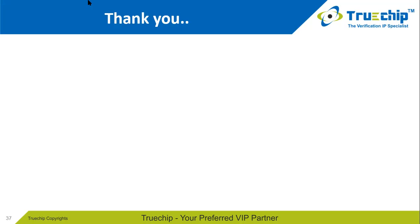Okay, this is an anonymous question. The user has not written his name, but I found the question very visionary, which is, can a large non-video file be stored in video class mode? I repeat, can a large non-video file be stored in video class mode? Yes, we can store that. This support is provided by the SD Association. But one thing has to be kept in mind, that the file has to be stored in a continuous location. So your data has to be stored in a continuous location like the video format. So your non-video file can also be stored in the video class format.